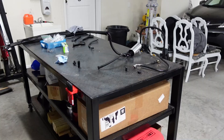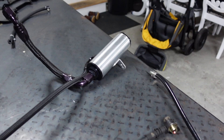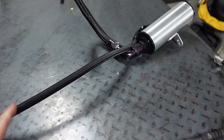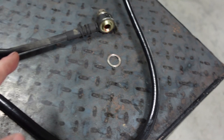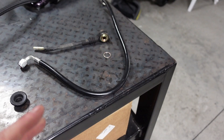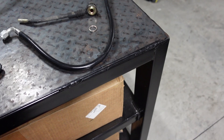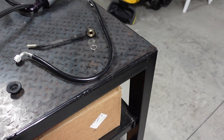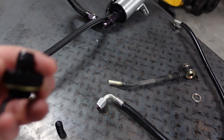The lines have probably seen some better days here — it's actually really stiff and hard. I am going to cut this one down. I just slipped this over the original fitting — this is a 17-millimeter fitting. This was the high-pressure hose I had from Drift Motion. I'll never understand why Drift Motion had this long hose on it, but when I got it I was like, what the hell? It literally went out and wrapped around my oil filter and everything — way too long. So I'm going to be using the Powerhouse Racing setup that I have on my wife's car, which is more direct, shorter, and perfect for this. I'm going to run this directly down into the rack now with the Powerhouse Racing fitting. This is supposed to be an M17 and a half — weird, right? I got an extra one for when this time came. Then use a dash six fitting at the bottom, straight. I already have a 90 up there, so I get to cut down this hose, add that, and put it on.